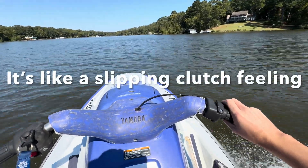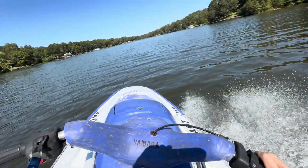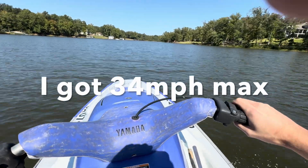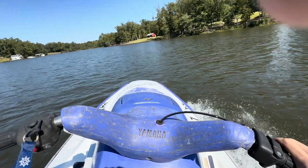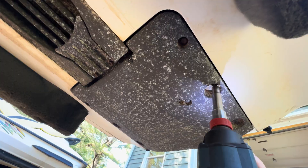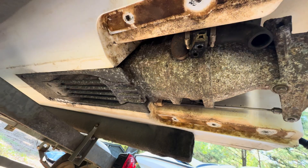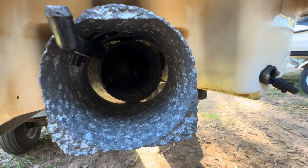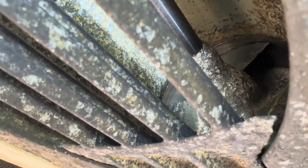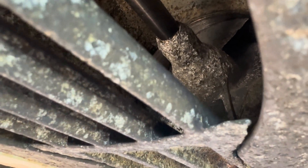As you can hear — you can tell this is in excellent condition because what other reason would I be replacing it, I'd just be doing it for fun. So here is the inside of the duct tunnel and there you can see the impeller, and that is in absolutely terrible condition. The wearing ring might be all right, but I just went ahead and bought the whole thing off eBay just to be done with it.